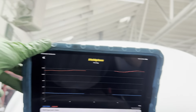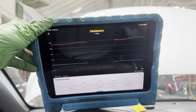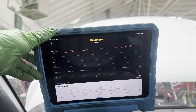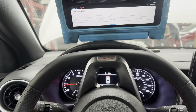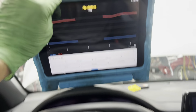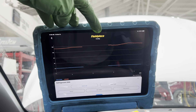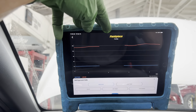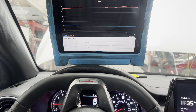Let's raise the RPMs. You know there are guys who try to get more refrigerant in when their can freezes up and they can't get any more refrigerant in - they say 'I'm going to raise the RPMs because that's going to lower the low side so it'll suck in more refrigerant.' Then you have those other guys who say 'I'm going to raise the RPMs to raise the high side pressure, so I'll just keep pumping in refrigerant until I get a certain high side pressure.'